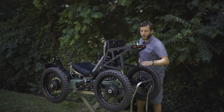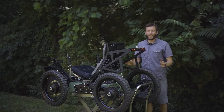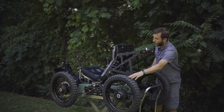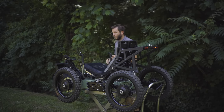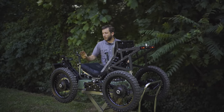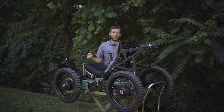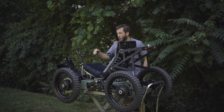There are no mechanical disc brakes on the rear because a lot of times that will induce tail slide and braking situations that the average rider does not want to experience. So there's plenty of stopping power with the electronic brakes back here combined with the front electronic brakes, and on top of that, the mechanical disc brakes. These disc brakes are actually 240 millimeters, so they're enormous. That gives you a great mechanical advantage compared with a typical mountain bike brake, which is about 160 or 180 millimeters on the disc rotor diameter. So that covers the braking and the throttle.